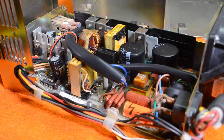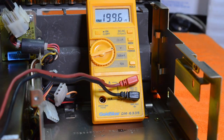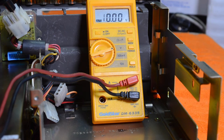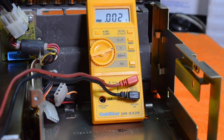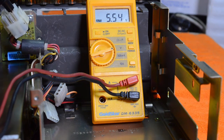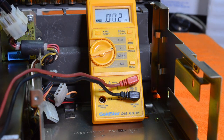So I think I should put it back together and give it a test. We'll check the voltages just to make sure it's okay and display it on my retro multimeter: minus three and a half, plus five, plus five, eleven point three, and minus five.